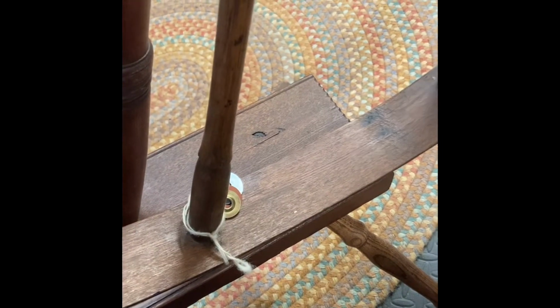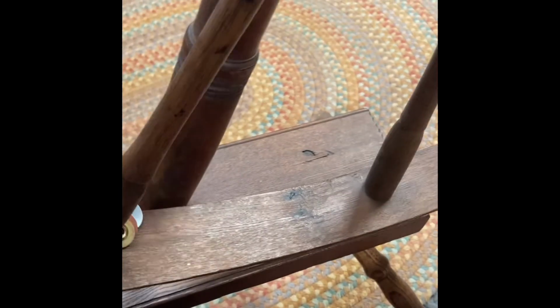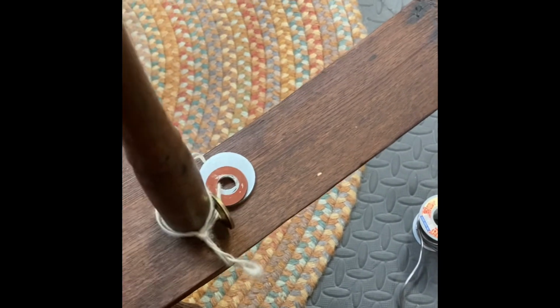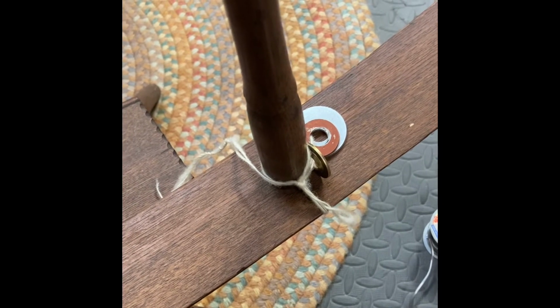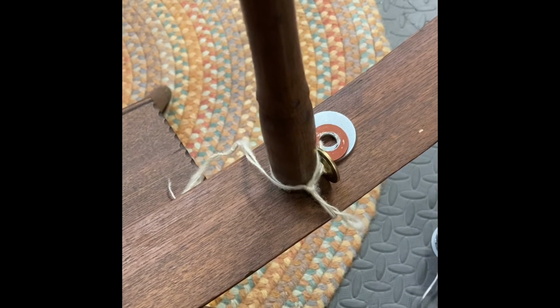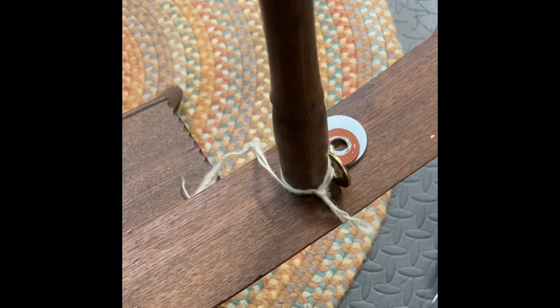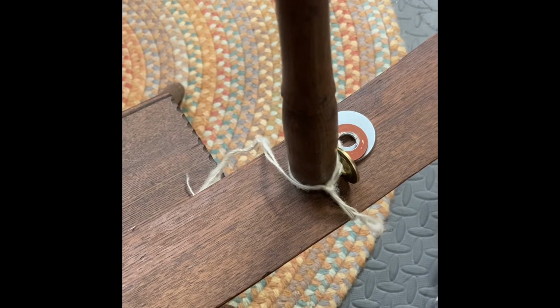So the great quest was, how do you balance a wheel? It took a great deal of time, just sitting in a chair. What I did is I would take multiple tie-ons of washers or nuts and put them on the opposite side of the weight to try and balance it out. And this one, it took several tries and several spokes. Sometimes you run into unbalanced wheels with perhaps spokes that were just not turned correctly.